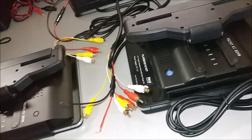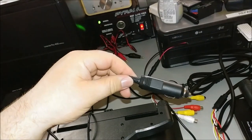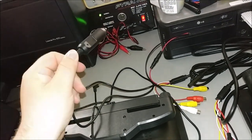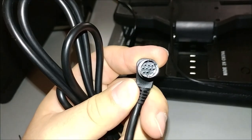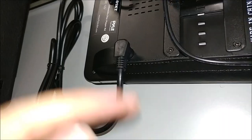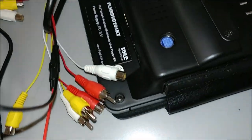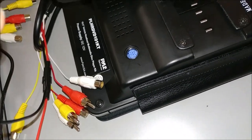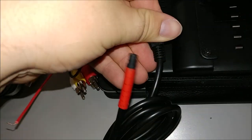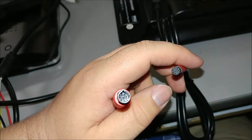The unit with the DVD player is your master — it has the outputs. For demonstration purposes I'm using a power supply for now, and later I'll show you how it looks in a truck. Plug this in here, just line up the pins. It's a 10-pin connector and typically it goes in a downward pattern for the slave, and the master goes in the same way.